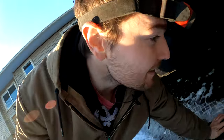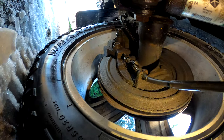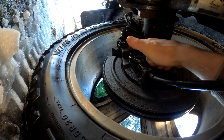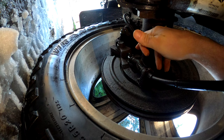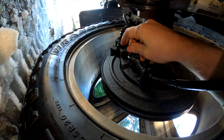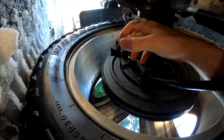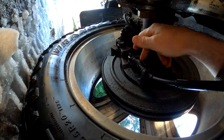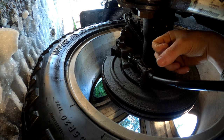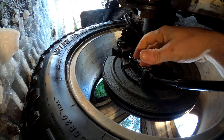I got my mechanic light on so we can get some visuals down here. This is your emergency park brake cable right here, and as you can see it hooks onto the actual mechanism which shoots your park brakes out. But this morning this was much more forward because with the corrosion these things tend to get hung up. What I did is I just took a hammer and a punch and hammered this back. I'll show you the other side in a second — it's a quick and easy solution but doesn't get to the root cause.